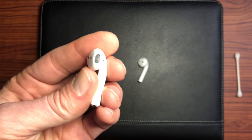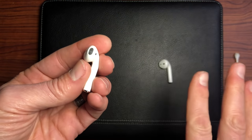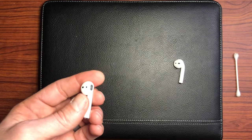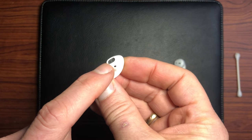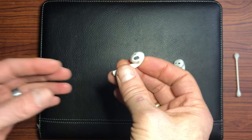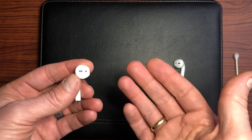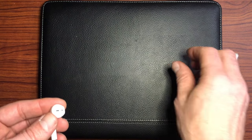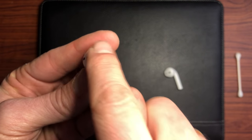What happened to me was when I just looked at the screen, it looked clean, but I was getting no sound out of it. I thought it was a software problem, maybe even a hardware problem, and I thought my AirPods have gone bad — I've only had these for a few months. But what I did was an additional step: I inhaled and exhaled. I blew through it and then I sucked on this front speaker, and that was enough to dislodge whatever was left in there to clear it out enough that I got my sound back. This screen had become clogged up even to the point where it didn't even look like there was anything in it.